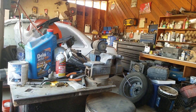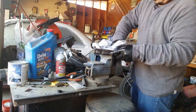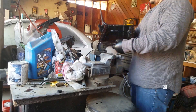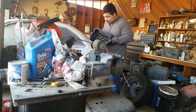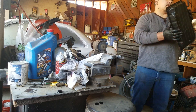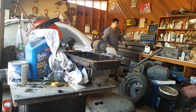What I'm doing right now is prepping the pan and cleaning up all the gasket material. After that, I'm going to hammer down the bolt holes, because somebody before me must have done a service and over-tightened the pan. When that happens, the bolts actually push the holes into the pan, and you've got to hammer those out, or else the transmission will not seal against the gasket — it'll leave loose parts of the gasket.